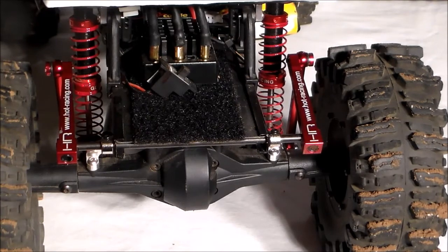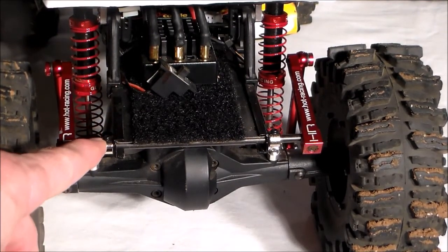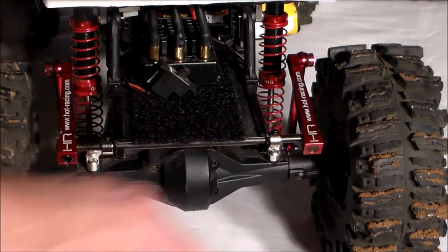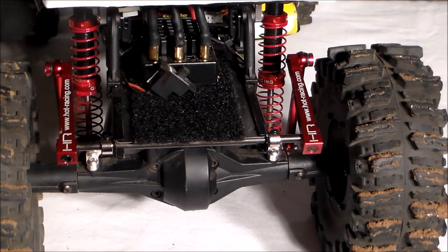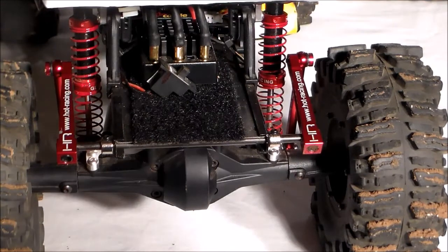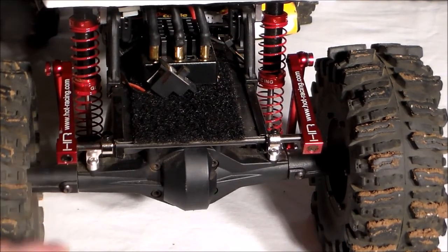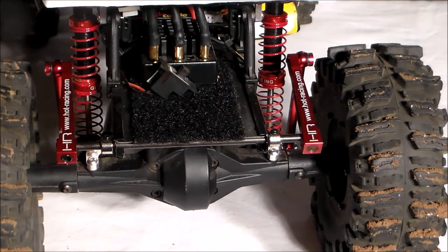Okay guys, so there's the kit. Everything that comes in the kit includes your two torsion bars - you'll get a soft and a hard - and they are pretty long, way longer than what you need. You're going to get the two arms on each side, and you're going to get the links to go to your lower shock mount and link mount that connect to the arms. You'll get all the hardware, all the O-rings, everything you need to bolt the kit together. What you don't get is the wheel collars - this little sleeve with the set screw in it - and you don't get a longer bolt for your lower mount. You're going to need about a 35-millimeter long bolt if you set it up the way we have, and I'll show you because there's a little spacer you're going to have to put on the bottom down there by your link and shock mounts.